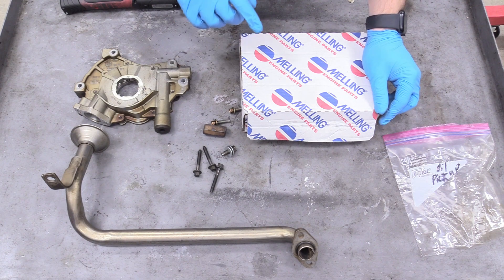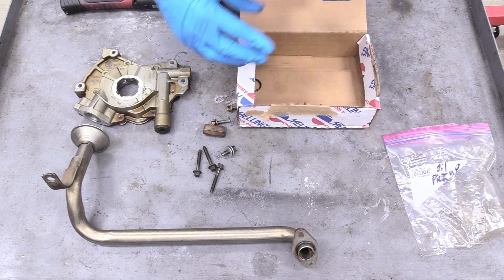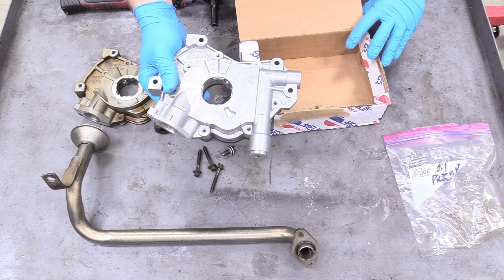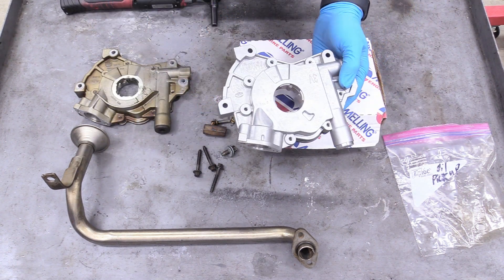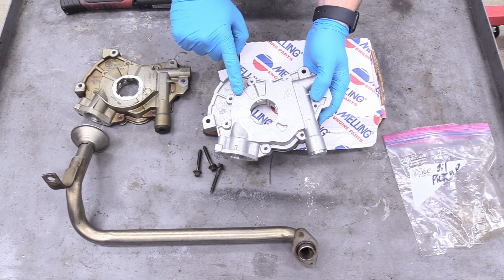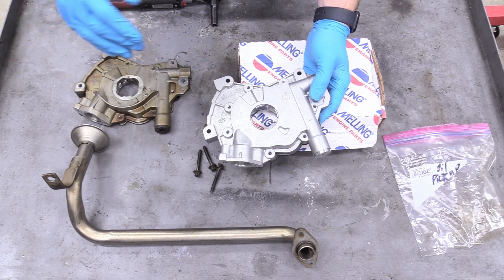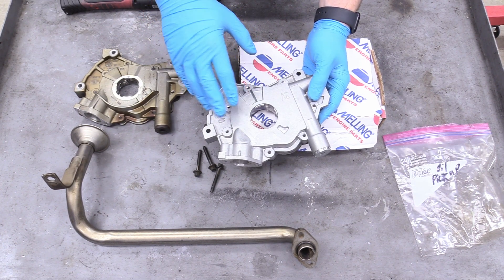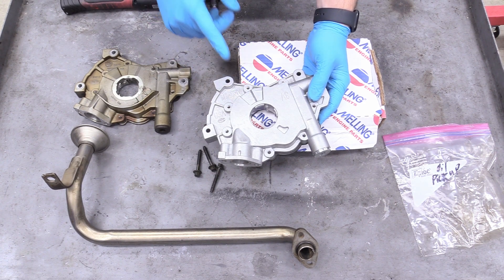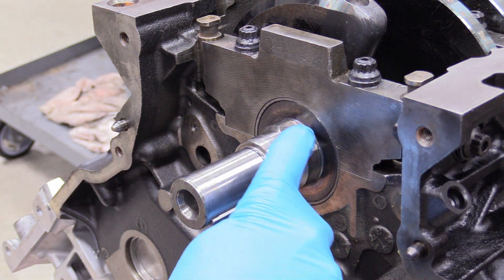The new unit sent over by our friends at Summit Racing is made by Melling — this is the upgraded pump, the new go-to part for this engine. Melling was able to cram 20% more volume into this oil pump, so it's going to keep our engine running really well. There are two versions: this is the stock PSI version at around 60 pounds, and they also make an 80-pound version. Since my engine is brand new, I'm going with the stock PSI but with more volume.